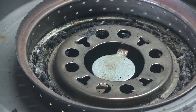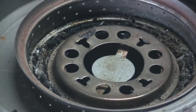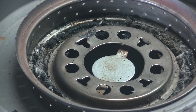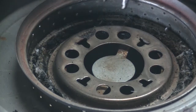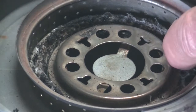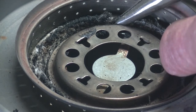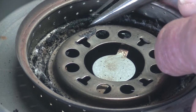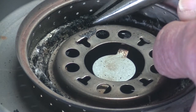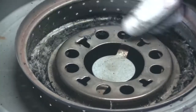Now I've let it run for about another hour and already I can see the wick is lightening up — it's not as black as it was. But there is a part over here that is still pretty black. So what I'm going to do is turn the dial to raise it to its maximum height, then get a pliers, put it in there and try to pull it up a little bit. If you listen carefully you can hear those little crystals cracking. Then I'll get an old toothbrush and give it a bit of a sweep.